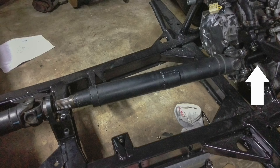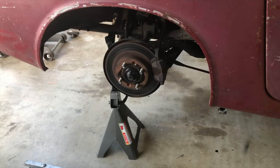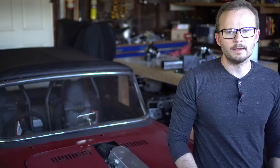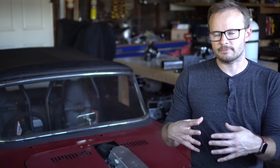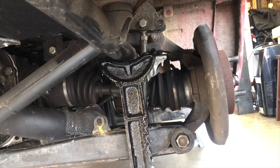Here you can see the adapter I made from the output of the engine to the drive shaft, the drive shaft itself shortened and balanced, the center carrier mounted to the frame, and a dirty sock. The cool thing about doing a lightweight car is that you can just grab junkyard solutions from something like a Miata and their performance upgrades. The brakes on this thing are from an NA Miata and they're way overbuilt for this car. This goes along with the whole hot rod equation — you take not only the engine from the bigger car, but some of the other performance components, shove them on a smaller, lighter car, and you're better all around. So an easy and cheap solution would be to get a Miata drive shaft, a Miata differential, half shafts, Miata uprights, brakes — and you know what, let's just put the engine in a Miata. No, no, too far. But with all the complexity of the drivetrain, that $6,000 Quaife unit is starting to look pretty good now, isn't it? No, because we don't solve our problems with money, because we're adults, and because we don't have that much money.